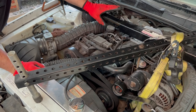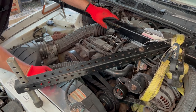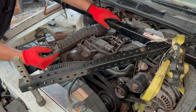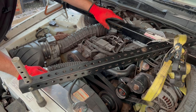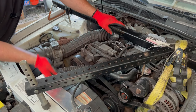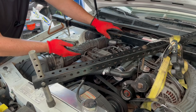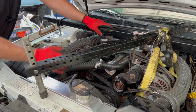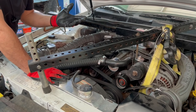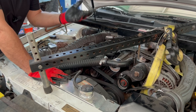I want everyone to get an idea. If you're doing a V8 car, you can use a bar like this — you can even use the single bar on the V8s. It's pretty easy to just take a nut and a bolt and either a chain or a cable and attach it to some of the studded bolts on the timing cover. And even if you're doing this on the ground where you lift the car up as high as you can with your jack and put some tall jack stands under it, you can do it on the ground. I've done it on the ground numerous times.